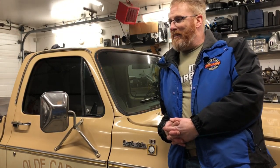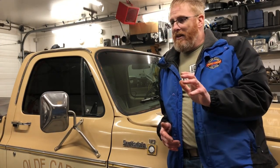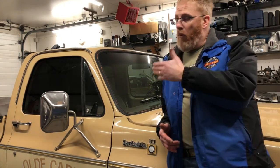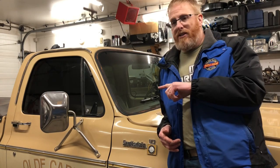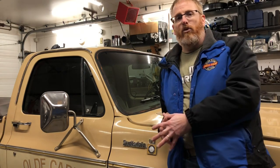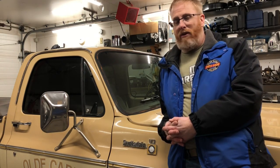So Junior was right. It was fuel. And like I said before, it makes sense that when I was putting my foot on the brake, all that fuel was sloshing to the front away from the pickup. Maybe mounting it in the rear of that tank wasn't the best idea. Anywho, it basically will tell us one thing. Once we get the gas gauge fixed up and if that issue starts, we'll be able to note where it starts on the fuel gauge. My guess is that it'll start happening probably right around an eighth of a tank.